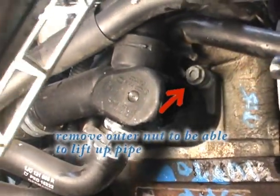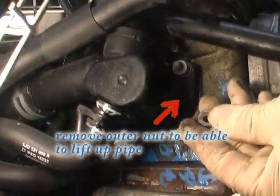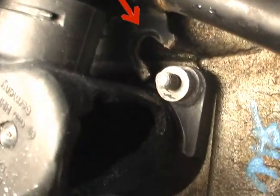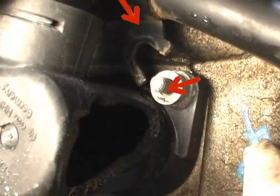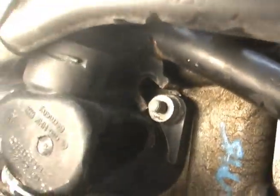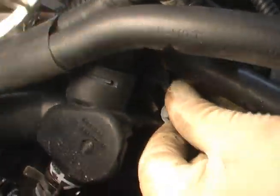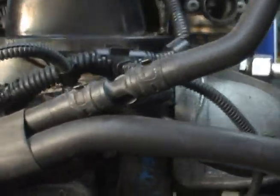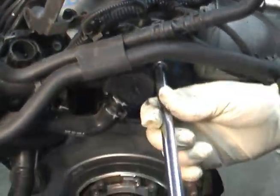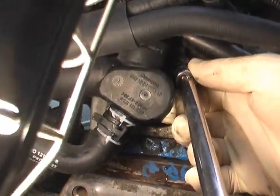You have to have enough clearance to be able to get that flange out, because that pipe goes right onto that stud, and that stud also holds the flange against the block. So the only way you're going to get the flange out is to get the pipe up in the air, and the only way you can get the pipe up in the air is to get that plate off the valve cover. That's why nobody else can make this video unless they've got the engine out of the automobile.